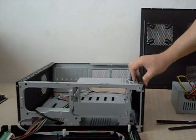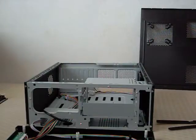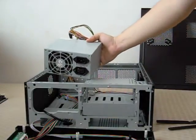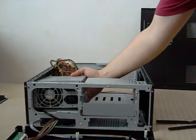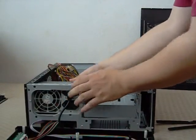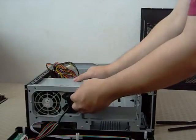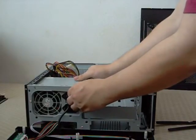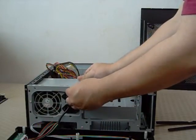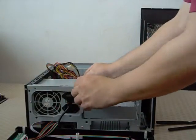Here's the thing, with the front panel open, is where we stick in the power supply. So if you had a power supply with a big fan at the bottom, this is up to the air vent. Push in, slide that in, like so, screw it in. See if I can get that screwed in. Screws obliging, because screwing in with your fingers is not easy. Let's just screw it a bit only. I'm not going to screw in much. Okay, so something like that.